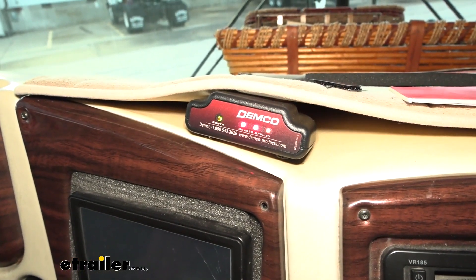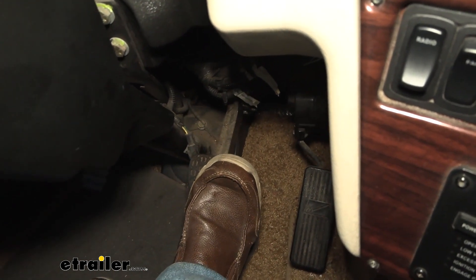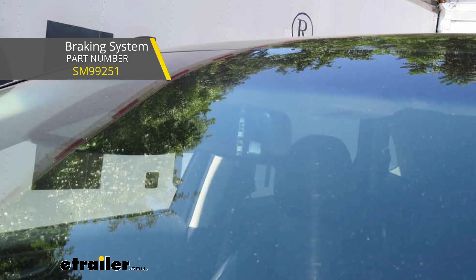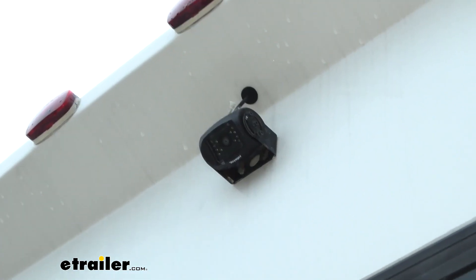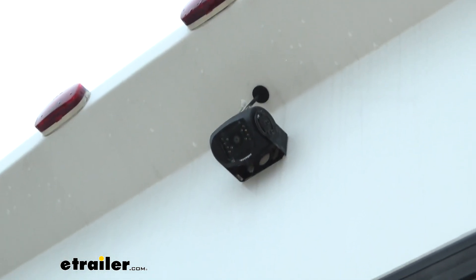In the RV, you're going to see the wireless coach link lighting up on the unit mounted on the dash, so you know when the brakes are being applied. The other option is the LED light that lives on the towed vehicle — if you have a rear camera or a window where you can see back, that's a great way to know that the brakes are being applied.